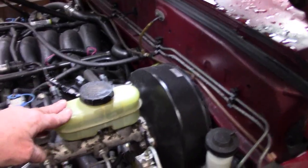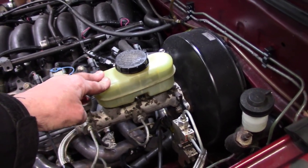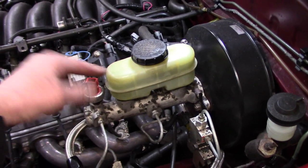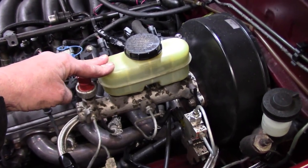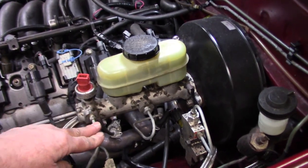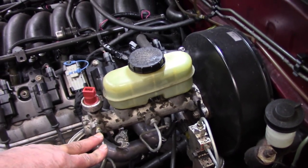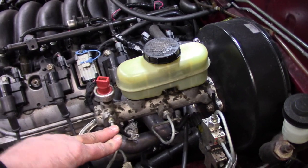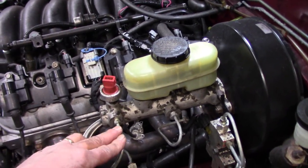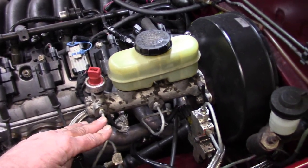This package works great with the rear disc brakes installed on the Ford 8.8 rear and the dual piston calipers from the same Ford Explorer — a 2000 Ford Explorer Limited, V8 all-wheel drive version, if you're sourcing parts. I do not know how this master cylinder works with the stock Mazda rear brakes. I actually did the 8.8 conversion first and ran the 8.8 rear disc brakes off the stock Mazda master cylinder. I did try the stock Mazda master cylinder with the front dual piston calipers and it just didn't work well — the brake pedal always felt a little soft.